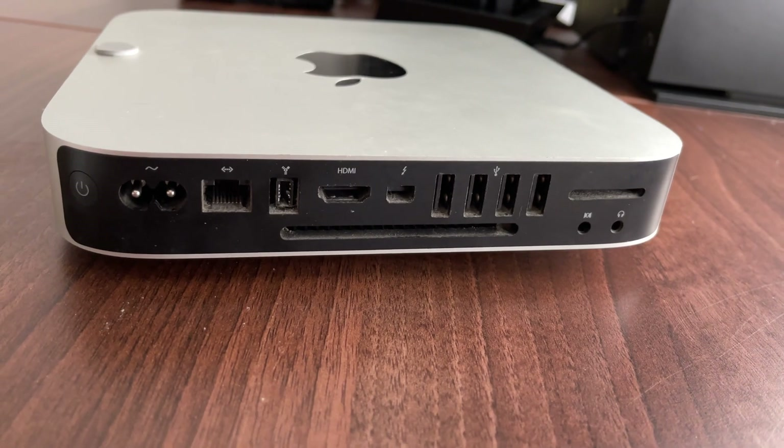So that's pretty easy, and then now I can put the antenna back on — and this is a real bitch, I wasn't looking forward to doing this. So I'm just tucking the cable back under the body of the case of the Mac there. And then what you have to do is line up the two tabs on either side with the screw holes that are drilled into the body of the Mac. I've had this with every single one of these I've taken apart — you can never, ever line the two holes up quite simply. They don't just slot in and sit.